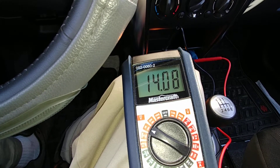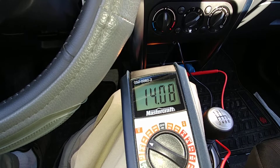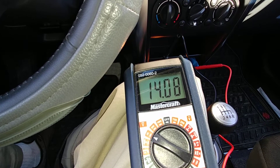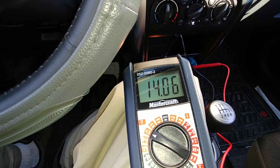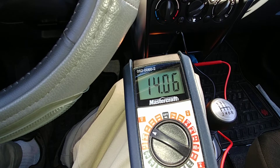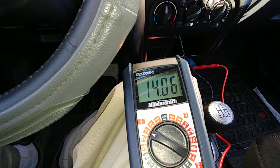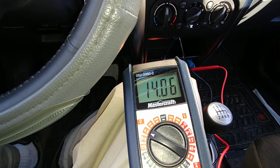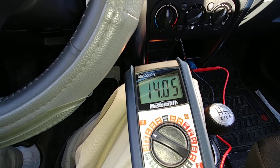The purpose of this video is to see if any other SX4 owners have the alternator acting the same way. This is, of course, replaced by an alternator or generator that I bought from Rock Auto. It's an 80-amp one, whereas the original one was 75 amps. I still have to bench test the original one to see if there's any problems with it, because when I replaced it I was down to about 12.2 volts. I didn't know if I let it idle enough. The whole purpose of this video is to inform other Suzuki SX4 owners — does your vehicle act the same way?